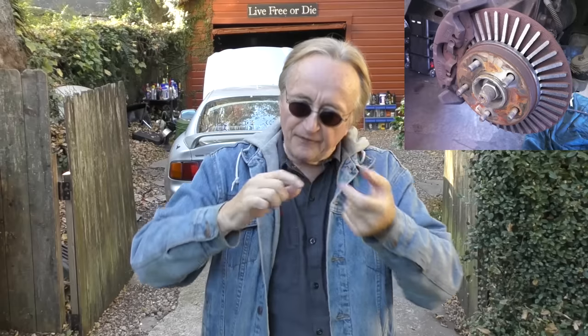So if your brake light comes on once every few years, hey, just add the fluid. But of course, check your brake pads then too, if it's been years, because they might get real thin, and that you can look at physically. But a lot of times, just adding the fluid fixes it. As long as it doesn't leak out fast, it's perfectly fine to drive it that way. If your brakes are hard and the only problem was the light was on, it's because things have worn and the fluid level goes down and you add a little up.